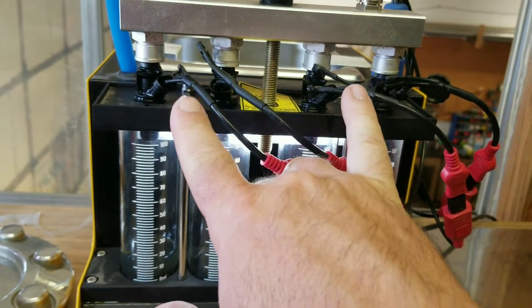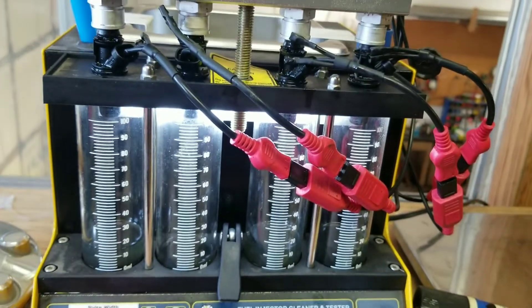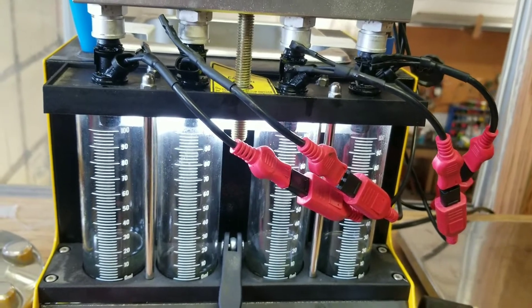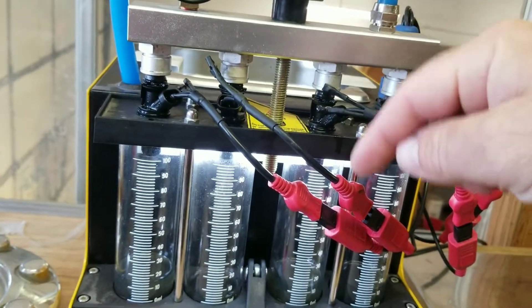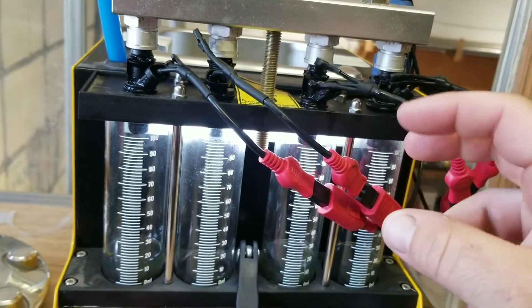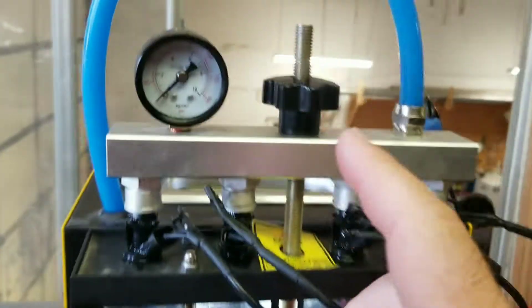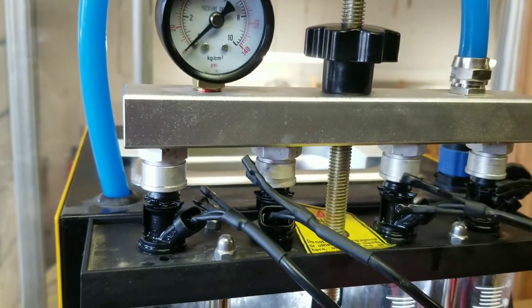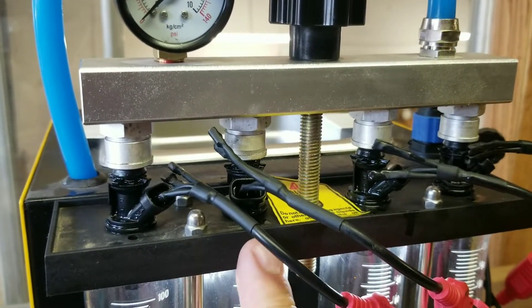I could flip these injectors over backwards. The tips on these are kind of complicated - they don't have a seal on them. So I can flip them backwards and inject fuel pressure through them backwards to try to blow anything out that may be in any screens or anything in there. I can set them in the heated ultrasonic tank and let them run for a little while, or I'll just end up replacing these injectors, or at least one injector.